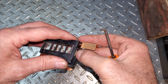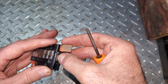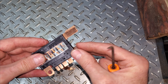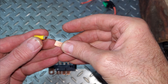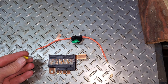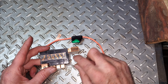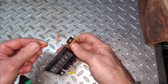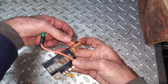The bar is out. It looks like there's a total solid copper bar all the way across the top, so I can't do anything with that. I'll put it back together. I think I know what I'm going to do — I'm just going to use a 30 amp fuse. Most blower motors are about 25–30 amps, so that should work just fine. I'm going to stab this down into the hole and basically bypass this fuse block — one end in the hole, the other end bolted right here.